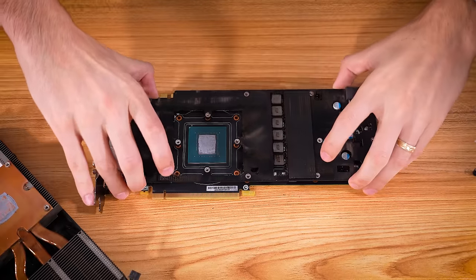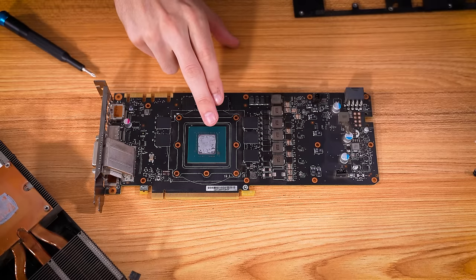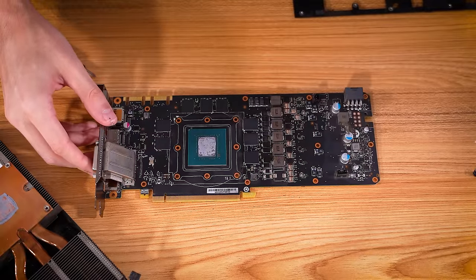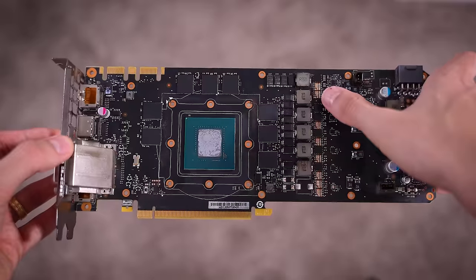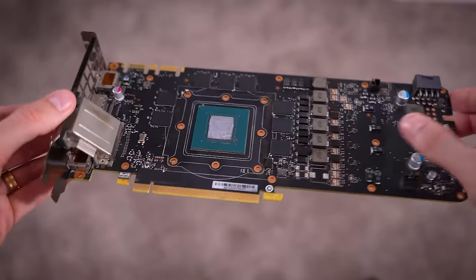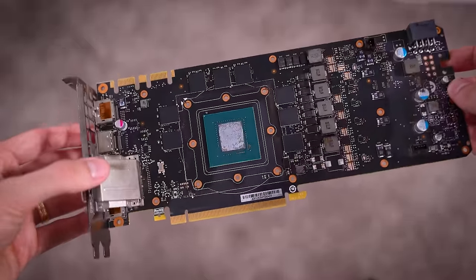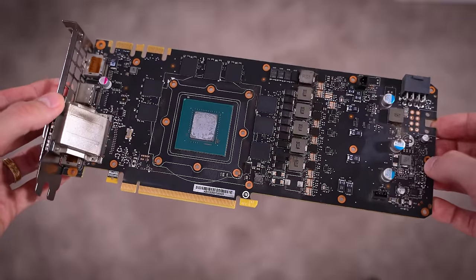This cover is pretty gross. You can see our VRAM, obviously the GPU there, MOSFET VRMs — everything looks okay, which tends to be how it works around here. In a lot of these cases you have underlying power delivery issues. I'd wager something in this area — maybe a dead short around the MOSFET area, or a partially de-balled memory chip or GPU. Sometimes when these boards get super hot they flex and expand and contract, and that can partially de-ball one of these chips. You always gotta be careful with that, especially with these larger cards nowadays that like to flex and bend heavily when installed in builds.